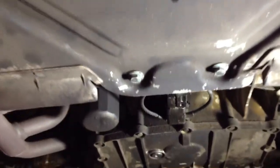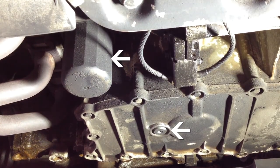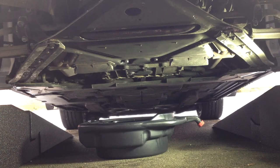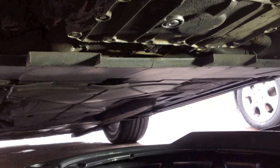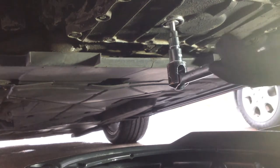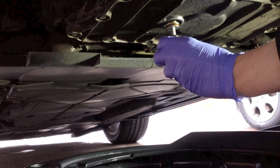As my Boxster is mid-engined I've raised the rear of the car. The location of the oil drain bolt is here and the oil filter is here. Place a drain pan down to collect the used oil. Put on eye protection, then using a ratchet or breaker bar loosen the drain bolt. Put on rubber gloves and remove the drain bolt.